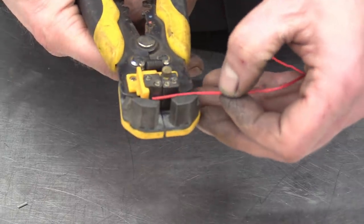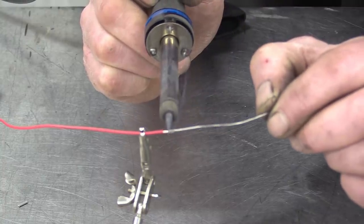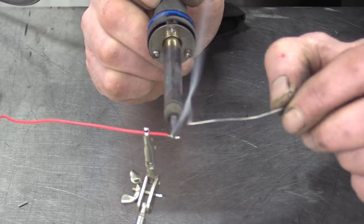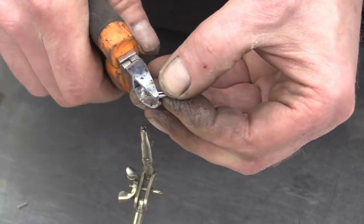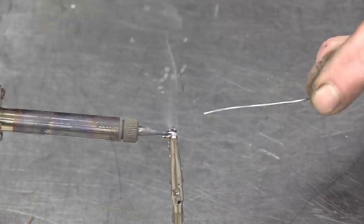The idea here, I think, is to shorten the housing enough to clear the steering rack and then attach a fly lead to each of the three terminals and then pot the cavity, making it impervious to water and vibration. The fly leads will then go to a new connector mounted somewhere we actually have room for it. Not that we have much room for anything, in fairness, but that's not my problem.